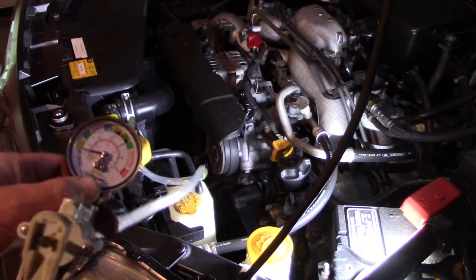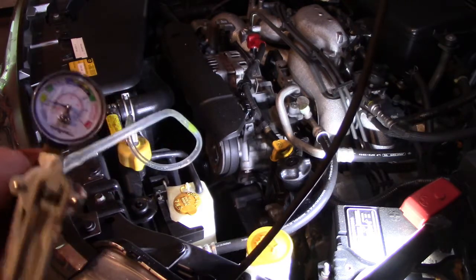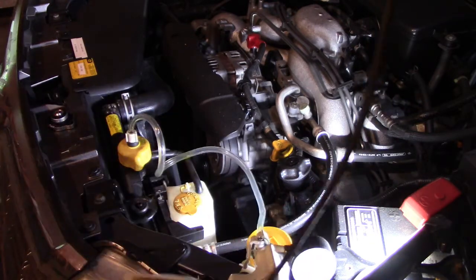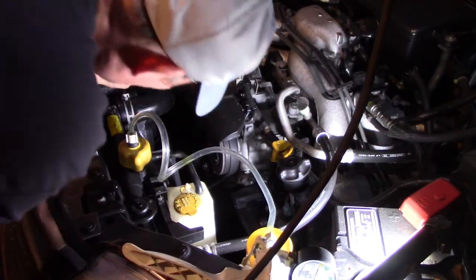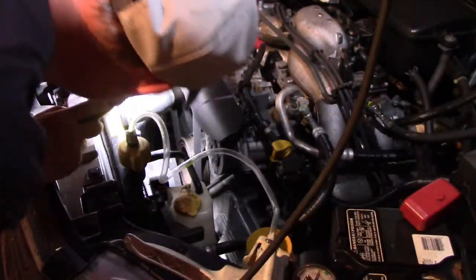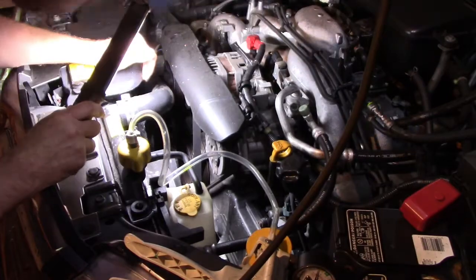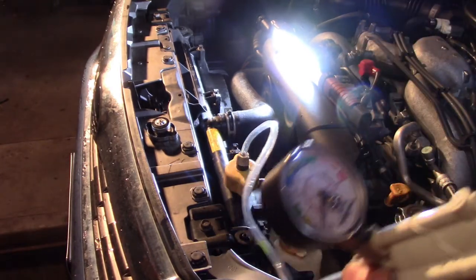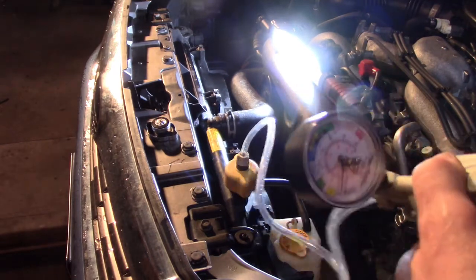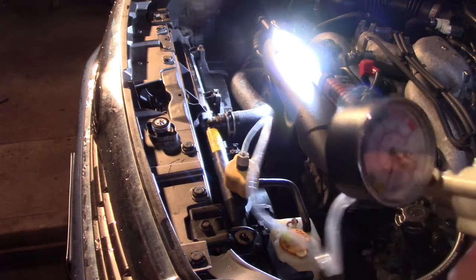It's difficult to get it up to pressure. I'm not sure if that's a cap leaking or — oh, uh-oh. Houston, we have a problem. I think the radiator's bad. I thought it was the cap but it's not. Let me take this duct off — I hear it hissing out under here somewhere. Turn it again and I can see something bubbling up. I was hoping it was the upper radiator hose clamp or something, but it's not looking good.